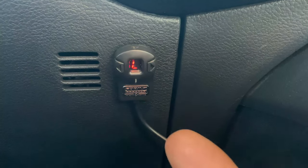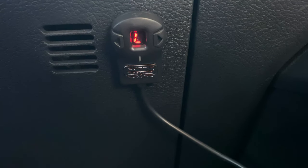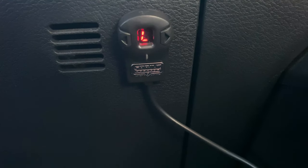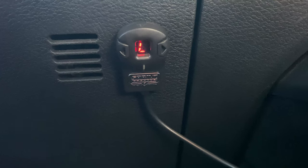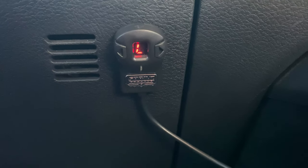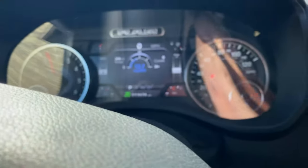Hit the big button again and now it should be saved. The L will flash on the screen for about 10 seconds, and during that time you can cancel the PIN — just push any of the three buttons on the sprint booster while the L is blinking. Once it stops blinking it's too late; your pedal lock is set.